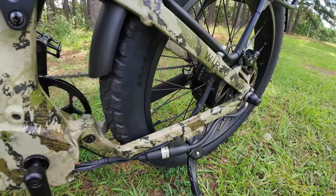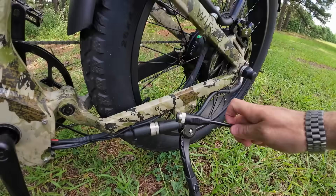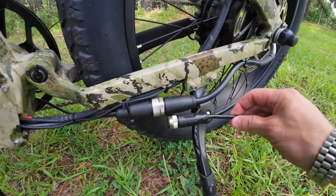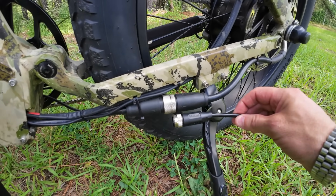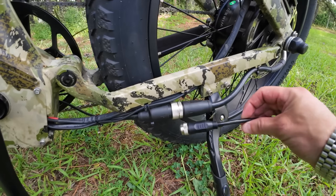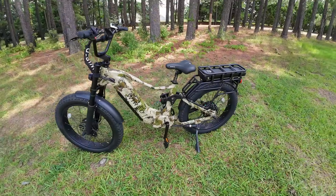That's because you're running so much power — 84 volts, 65-amp controllers. Your wiring and plugs need to be able to handle that, so they use this massive motor plug. It's like comically large, but I'm glad it's there so you're not frying the system.